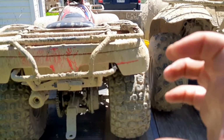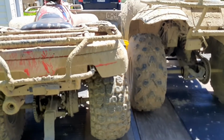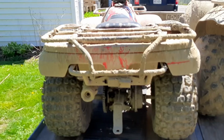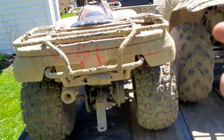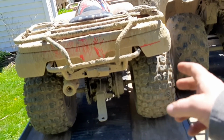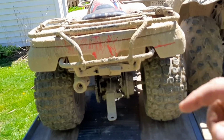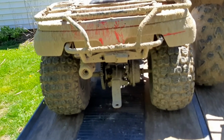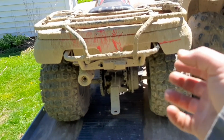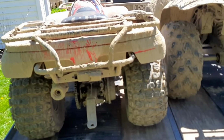Sometimes the brake pads wanted to kink, they wanted to tilt over and lock up the drum. So one way to combat that is to raise up the rear end and then turn the tires as you tighten up the brake. So you can take a wrench, push the brake drum, get the brake drum started, get the nut started, and then just turn the tire and hold the nut with the wrench. That way the brake drum walks its way over to where it's supposed to go, and that way the brake pads don't tilt as hard.